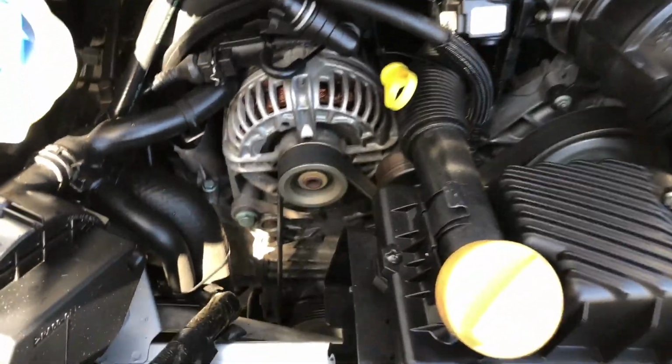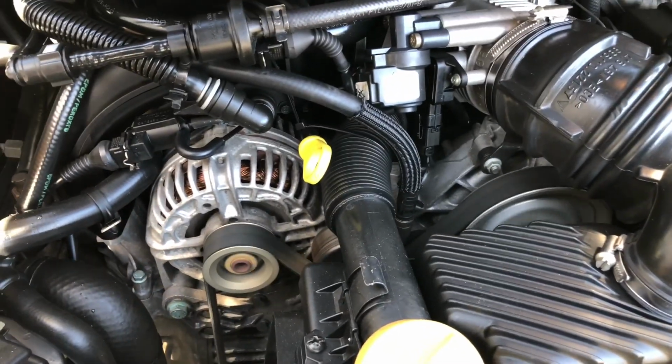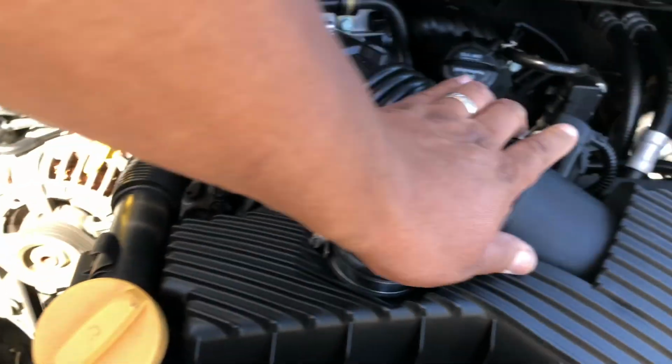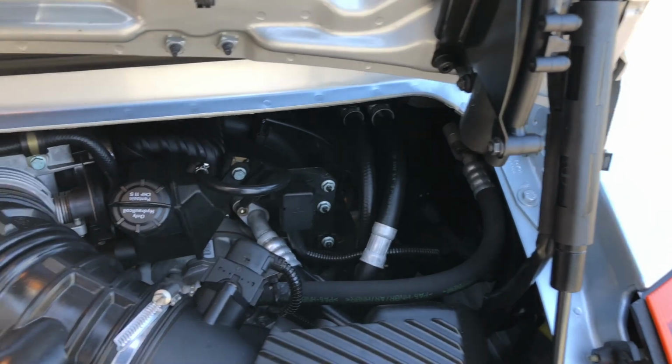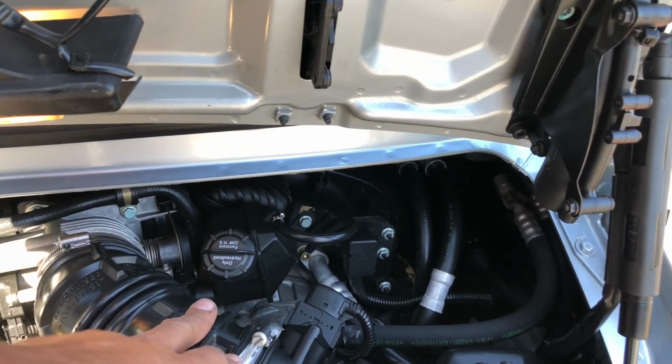I've already got a nice clean shot of the engine belt when it was off idle. I didn't see any cracks there. I pulled the oil, looks fantastic. Didn't see any signs of cross-contamination. Coolant looked decent as well. The hoses, the ones that I could feel, still feel decent. Check the hydraulic fluid as well.